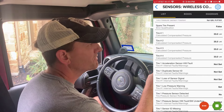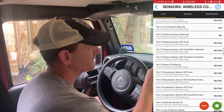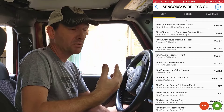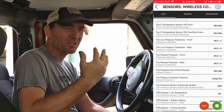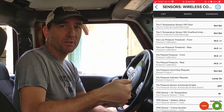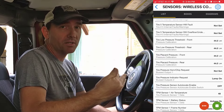Scrolling down a little further, this is where it really showed me where my issue was. When I was having these problems, my tire low pressure threshold for the front and rear was at either 0 or 99 — not a valid number. Something had set those values to a number that could never be reached, which is why it was throwing that indicator alarm all the time.